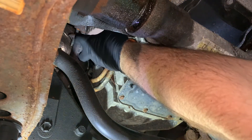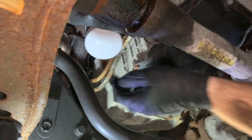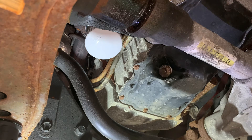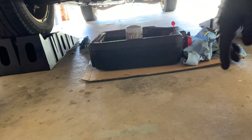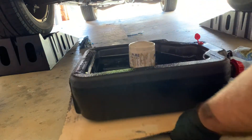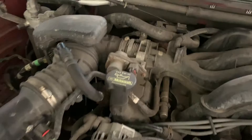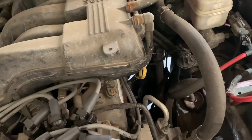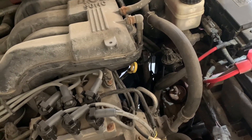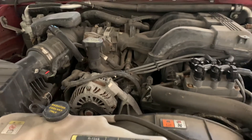Just want to get it tightened up here — just hand-tightened is good. Can't tighten it anymore with my hand, so we should be all set. Let's go ahead and get cleaned up and we will get the new oil in the engine. There's our oil fill over there; the yellow thing down there is our dipstick, so we'll check it with that. We know it takes at least five quarts, so we're going to do that, pull it off the ramps, and then go ahead and check it. If we need to adjust it, we will put more in.